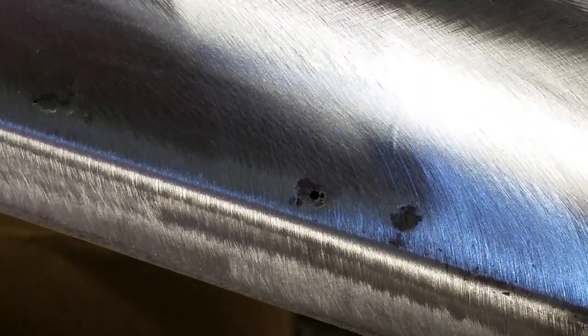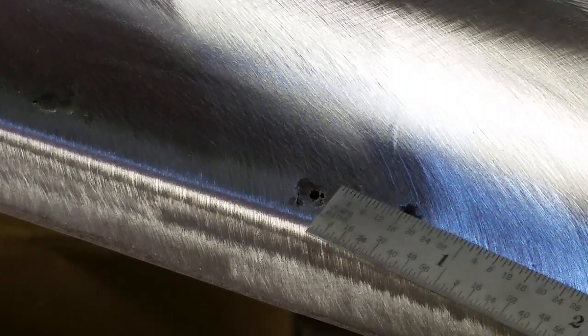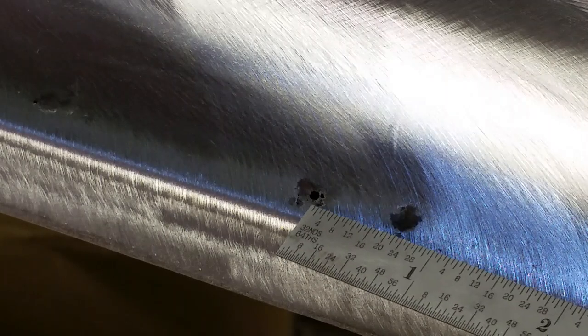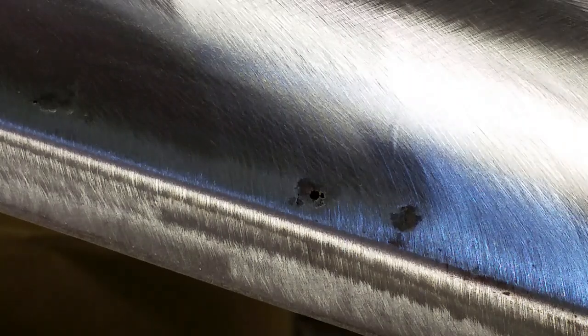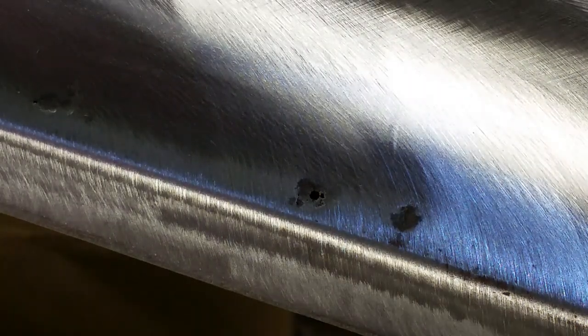What I'll do is take a hammer and tap that in to create craters around this. This is also good to do around the windshield frame or window frames — those dog legs rust out because they collect water and trash over the years. It's an excellent way to repair that. If you want to practice first and you have a car with a lot of rust, practice on those parts first because you hardly see them once the glass is put back in.